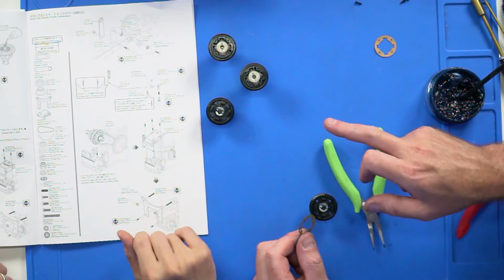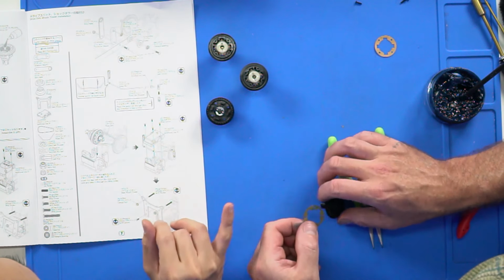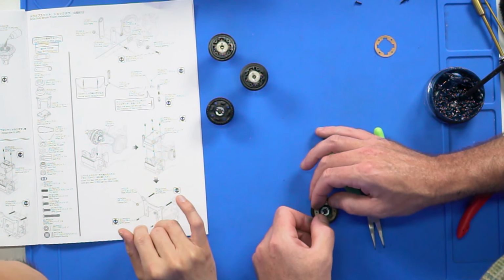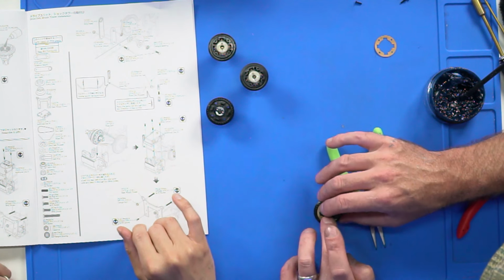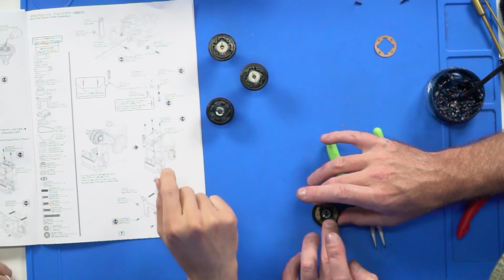Are they saying to put it down or put it in? They're not saying anything, but I suggest putting it into the pulley side, because it'll line it properly. And it won't get caught on the fingers. That's right. Because you don't want it to accidentally get cut as you're screwing it up. And because it's got the square fingers up here, those locators, it's going to locate that gasket perfectly with those little screw holes. Now, it's a bit of a mucky job, but that's okay. Like I said, there's not much grease on there.